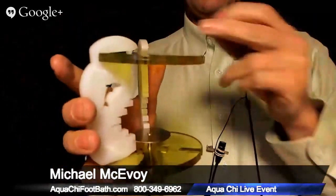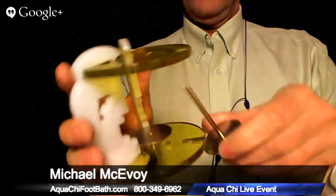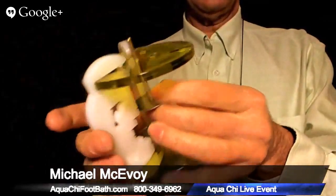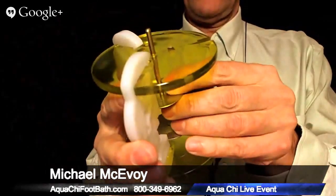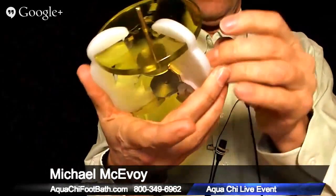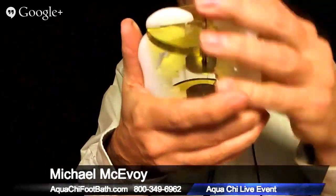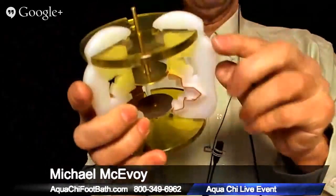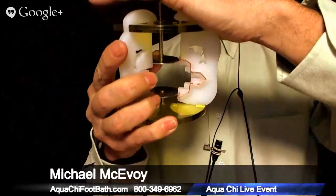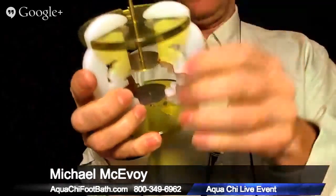Okay. Now, while it's in this position, that's where you're going to put the new post back in because you've got it the way you want it. So let's do that. Put the new post in and line it up with the little slots on either side in the legs. And once you've got them lined up, you can push in the white leg. And the same thing for this. Use the heel of your hand and push while holding the other side of the module. And you'll hear it click in.